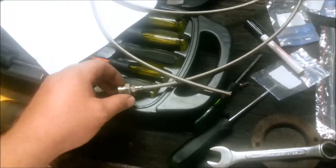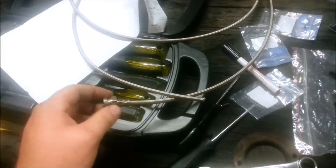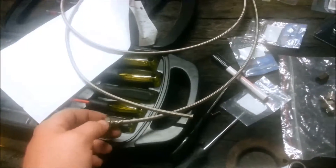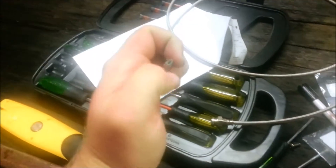I've already got one line end put on, so I'm going to go down to the car, screw it on, run the line, cut the line — you can just cut this with tin snips — and straighten everything up and put everything together.